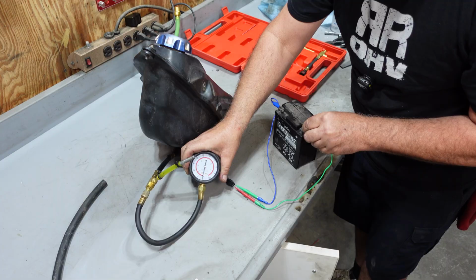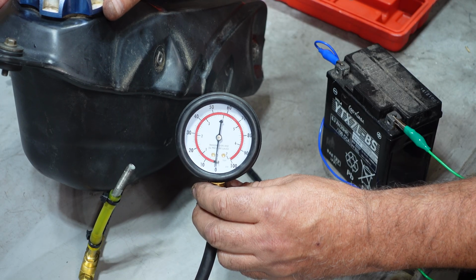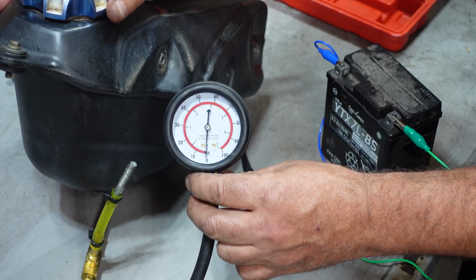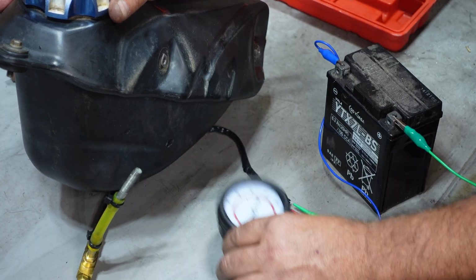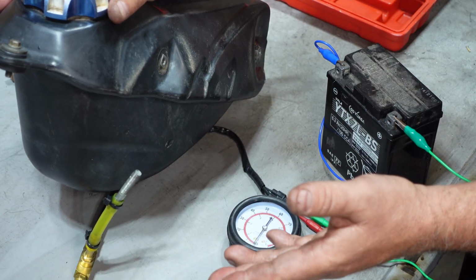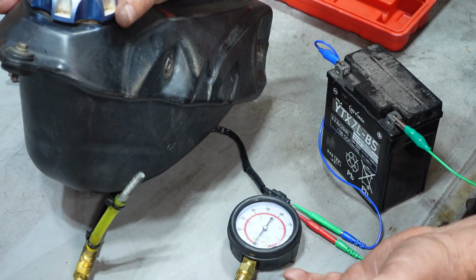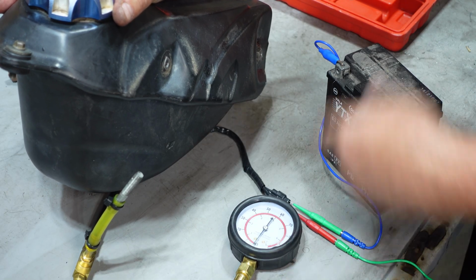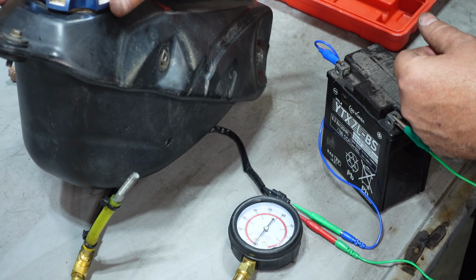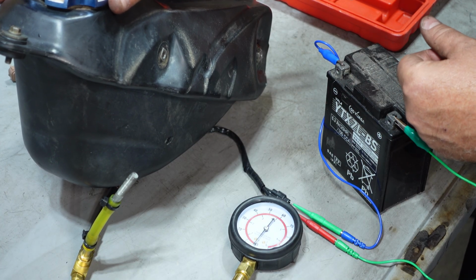So I'm not sure if y'all can see. So we know it's flowing some fuel and we can hear the pump running, but we have exactly 0.0 psi, which means that this housing inside here is either cracked, or the O-rings are bypassing, or the fuel pressure regulator has failed and it's hung wide open. So it's just internally bypassing. We're going to go ahead and pull that fuel pump out of here and take a look at that in depth.